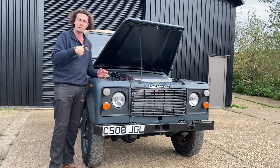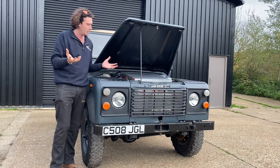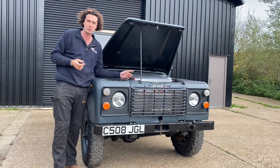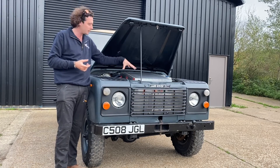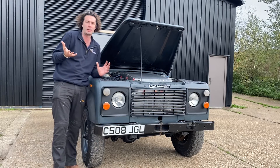All that's happening is it's being turned by 120 horsepower worth of electricity. That motor is linked up to five Tesla batteries in a box up the front, so all five Tesla modules sit in the front running this car at approximately 125 volts.